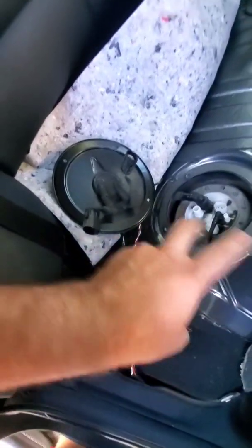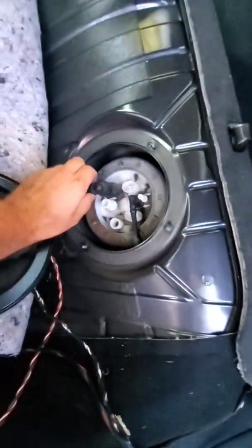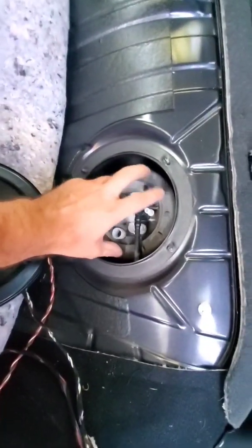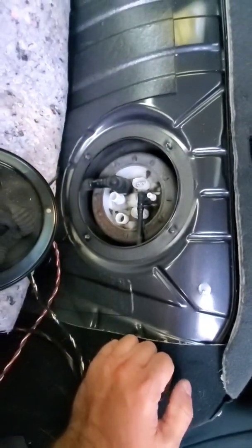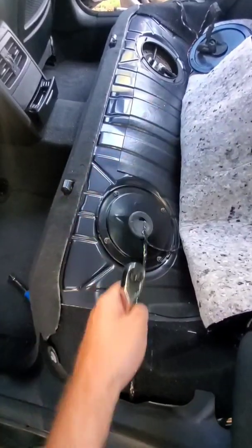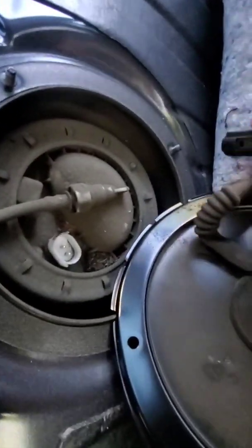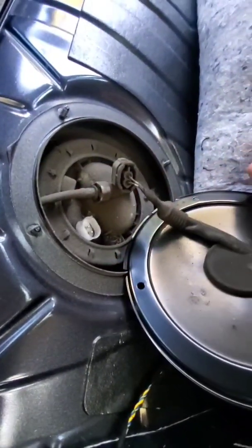So what you do, unplug the electrical stuff, run the car so there's no pressure, unplug the battery, and unplug these guys here. Then we can use a tool to remove this ring and pull this guy out. More on this coming up. Now on the other side, this is where the filter is. We got to remove this and repeat the process. Unplug this guy and vacuum all this stuff out. Unplug this as well, cover it up because you might have fuel leak from here.